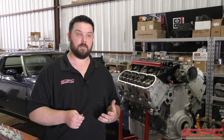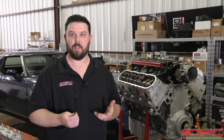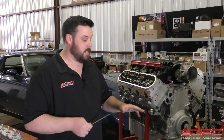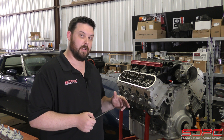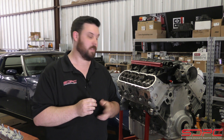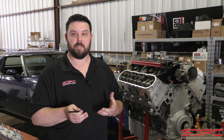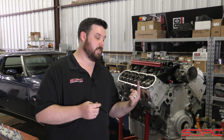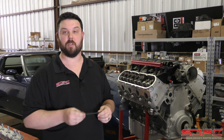Today, as time has gone on, there's a lot that's been done to these engines. We're all picking up used parts from the junkyard — we don't know where they've been, if they've been in a machine shop, if they've been decked. You could deck the block, use a different thickness head gasket, deck the cylinder heads, and of course the base circle of the camshaft changes how far up and down this comes. Another one I've noticed is valve jobs — a valve job doesn't move the valve too much, but I've seen some where it really seats the valve pretty deep, which makes it come out of the head quite a bit more, and as it hits the rocker arm, that can change your pushrod length too.